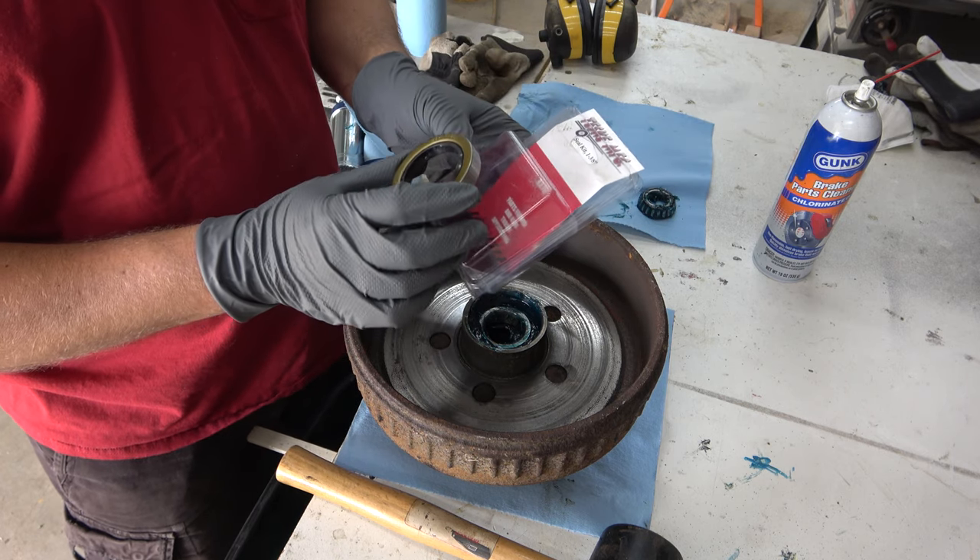Project's done — that's all there is to it, pretty simple, as long as there's no damage. Once you get into removing those races from inside the hubs, it can give you some trouble. So if everything's working good, just put some more grease in there, put it back together and it's a real quick job. Thanks for watching, hope that was helpful. If you want more information, just go to GoMidwestFishing.com and I'll have a blog post on it up there soon. See you next time.